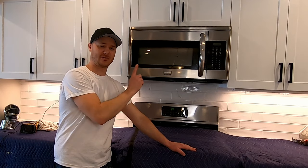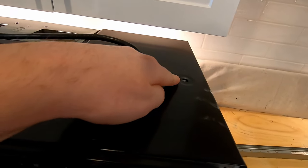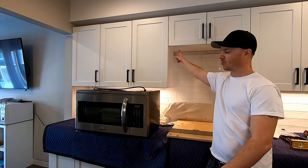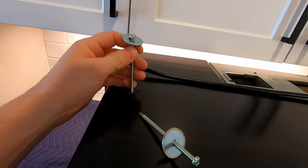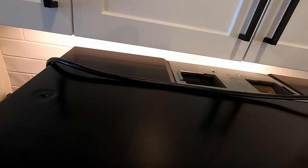Hello, I'm Brent and I'm going to be installing a microwave range hood. These all work very similar. There's usually two screws that go in the top on each side, near the front. They have big washers on there so you can get away with a half-inch hole usually, and if you're off a little bit it's not the end of the world.